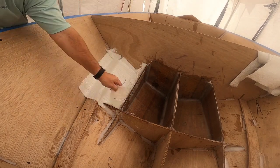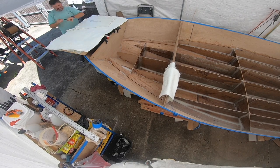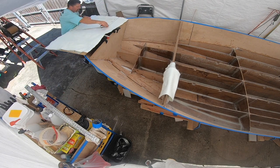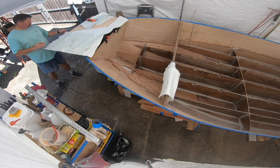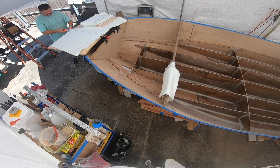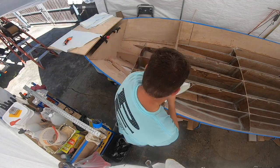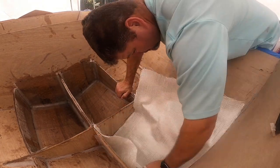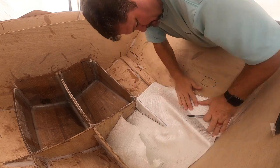I try and show this whole process — not everything is good in time-lapse, but it does help speed things up. So here on the port side, all I did was take the patterns I made for the starboard side, cut another piece of fiberglass, and laid them on top to cut mirror images so I could use those to get started on the port side. Had a little camera trouble so not everything shows up, but basically the same thing — cut them out a bit big, put them in there, mark them, label them, orient them. Putting those black marks in the seams and where your cuts are is a big thing, so when it's all wet and you go to put it in, you know exactly where it goes.